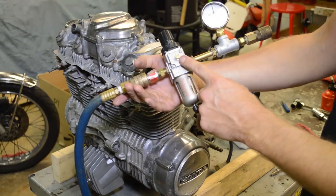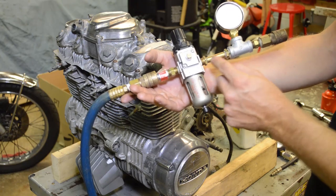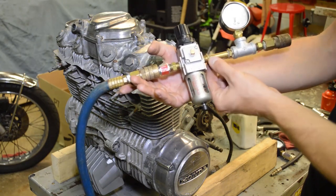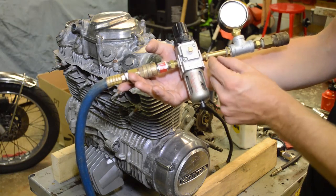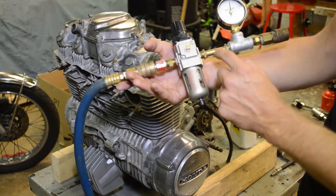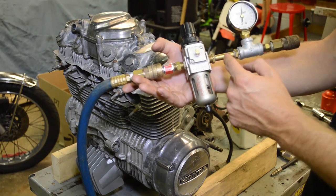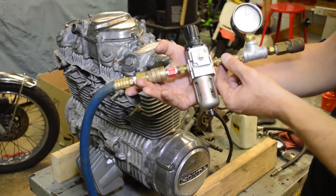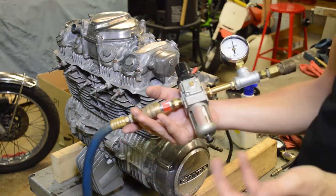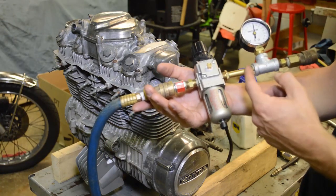So I have a pressure regulator, air comes in, I can regulate this down. This is the only custom piece, really. This I filled with epoxy. It's just a 2-3 inch long nipple. You cap it, you plug it with epoxy, half inch, quarter inch, whatever, then you drill a hole in it, a number 60 drill bit. It's a 40 thou orifice, and that is just some kind of restriction that is good up to 1,000 cubic inches or something like that. I can link to the Wikipedia page so you can read more about it. So that's the only real magical thing about this.